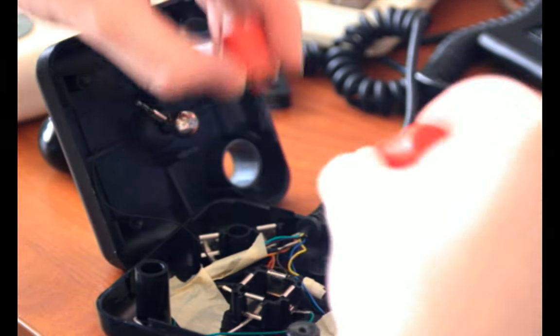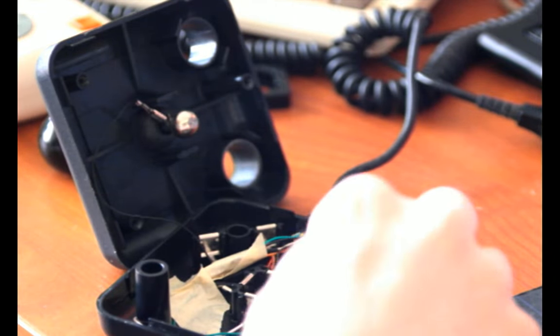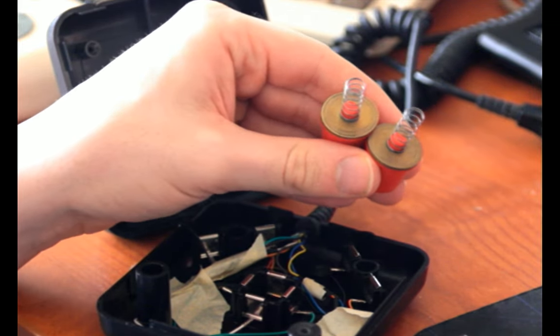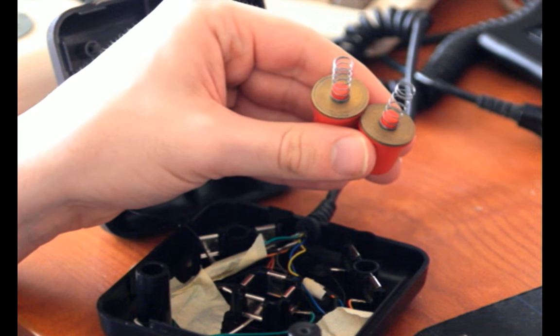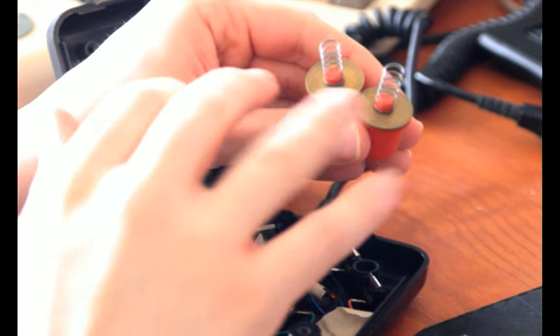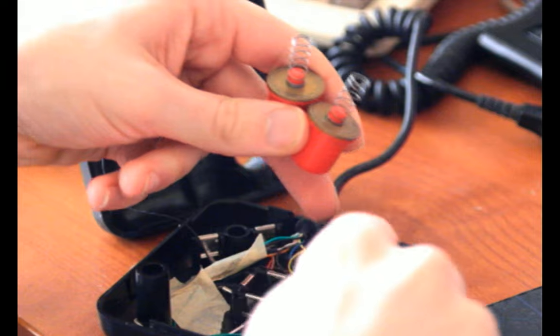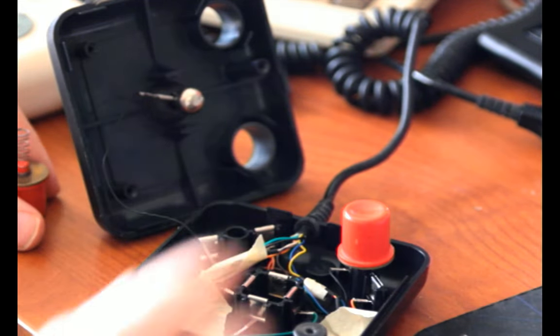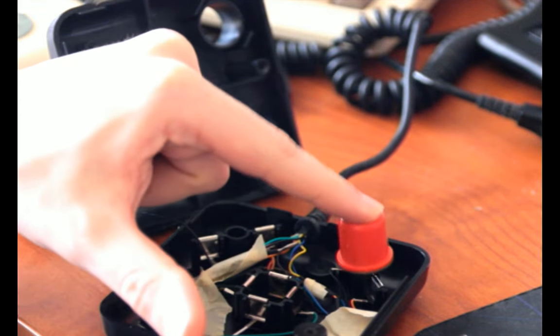So there's two fire buttons. Fire buttons use the same kind of contacts, hooked in on the plastic shell, and then they have these brass washers on the undersides of them, unlike the Atari sticks, which just press down on a steel plate. These actually have these washers come into contact with these points, and when they bridge between both of them, that triggers the fire button. And it makes a nice kind of loud noise because of the metal on metal contact.